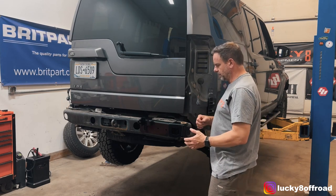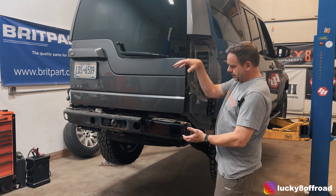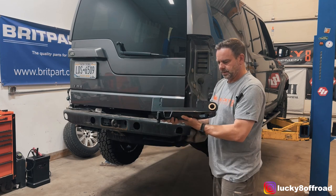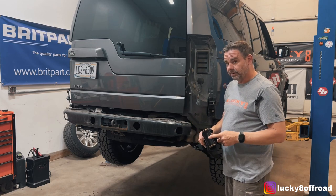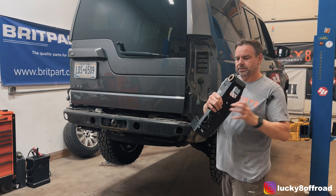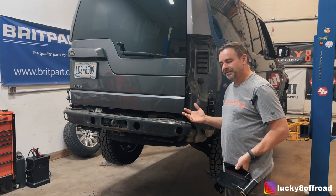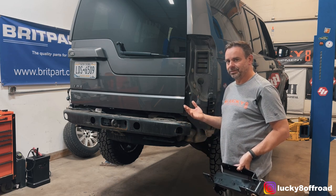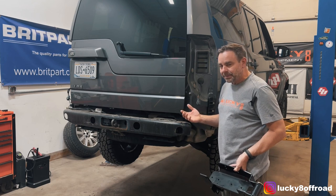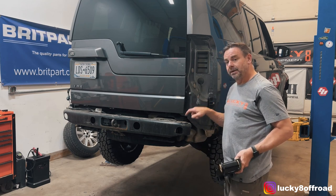Now it's time to get your gloves on and get ready to cut. On to the cutting portion of this video. What we're trying to do is install the main frame for the swing away — you can see that it kind of goes right here on the bumper. What we're trying to do is notch enough of this out of the way to allow for the swing away portion to fit and also give us a bolting point on the top. I'm going to mark it up and try to give you guys some quick measurements. I'm going to sawzall this — you can use a whole bunch of different tools to cut it. I happen to be a Picasso with a sawzall, so that'll be my choice.